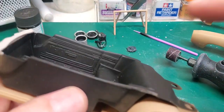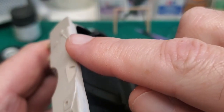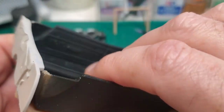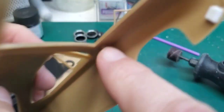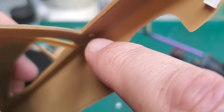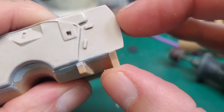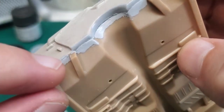We still have to put the windshield in and cut it to fit this weird area, because this isn't a proper kit part — we had to modify it a little bit. This piece here also needed a little radius work to fit right through here. For some reason it fit great on the passenger side but didn't want to fit on the driver's side, so we did some sanding, tightened up the radius, and got that looking a lot better. We're also going to fill this little seam here.